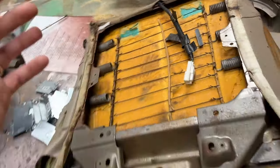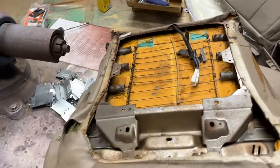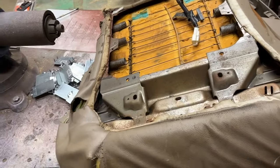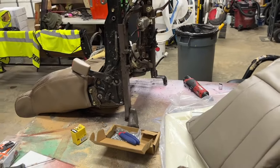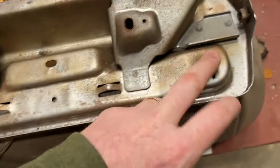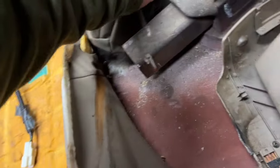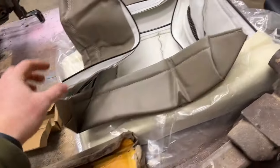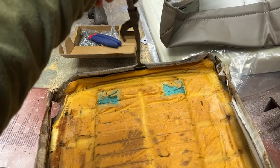The wire goes in and I have no idea where this heater goes. I'm hoping it's something I can transfer over because that was the main part of why I wanted to reupholster it myself — because of the heater. I like that function. I've never actually had a car with a seat heater and it's winter time here. This thing is disgusting — gonna hit it with some cleaning wipes. You've got hog rings here — these are actually called hog rings. You've got a few down here and then three on the side. There's a little wire along the side and I have a plastic part on the new seat so I'm assuming that's going to take its place.